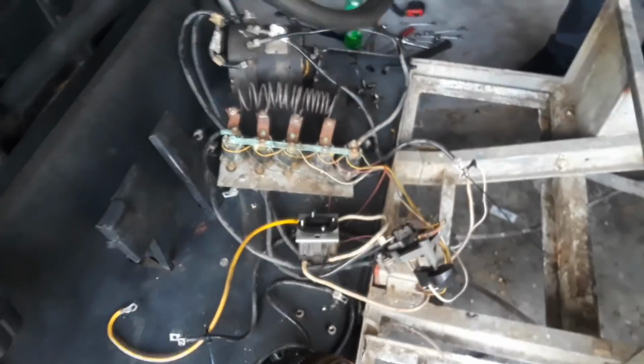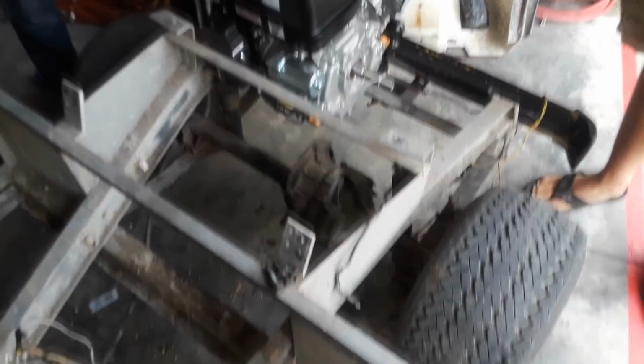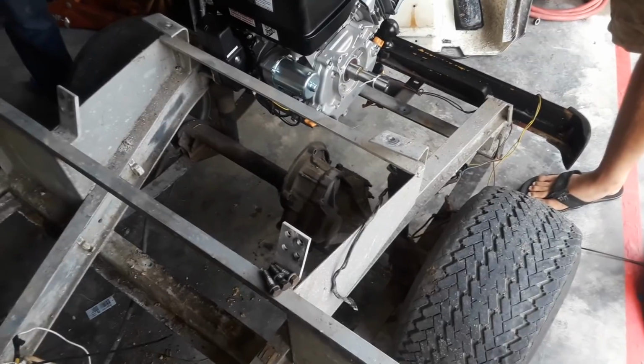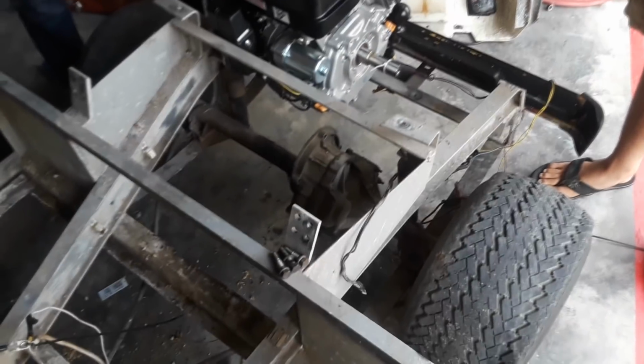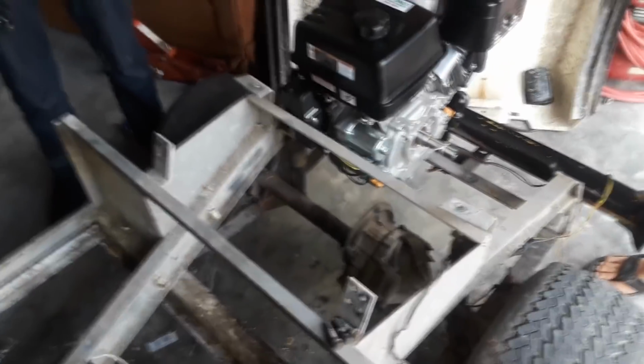420. So you're probably going to have to just do the straight sprocket on it instead of a torque converter now, because the torque converter is going to stick out too far if it sits back here, yeah, for sure. Originally I was planning on putting it under the seat. It's big, so I don't know if that's going to work. I don't even know if a 212 would fit under the seat. I've seen videos of them done.